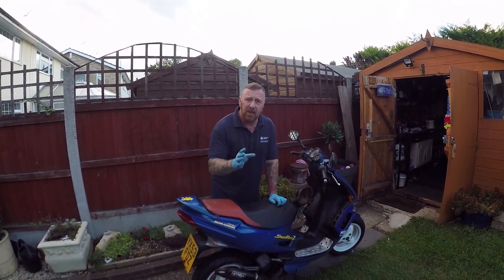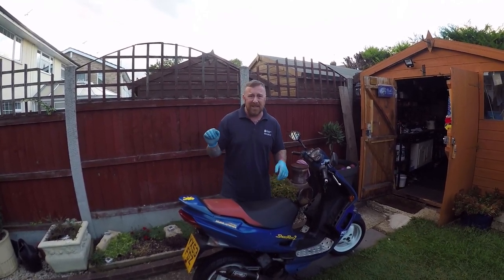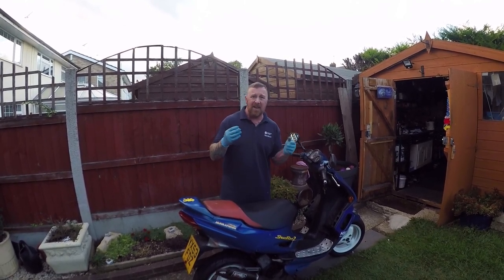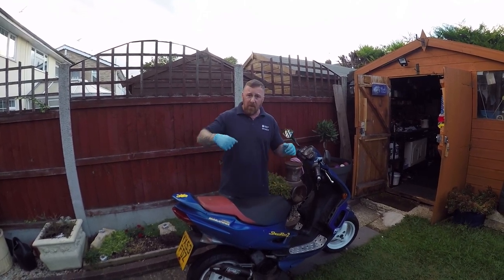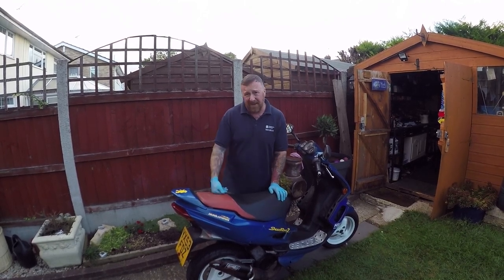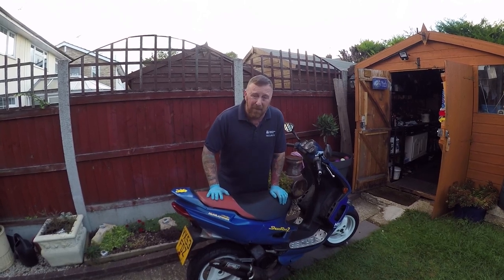Now, don't get mistaken, I've got a guy who keeps messaging me. He pulls away, does it for about 20 seconds, and then the bike dies. That's to do with your petrol level, your float, how much you're sucking out of it, and all that lot. Forget that, this is just bogging down. So the moment it's on a stand, you can rev the nuts off it. When you take it off the stand, you put your weight on it, you go to pull away and you can stall. That's literally how bad it is.